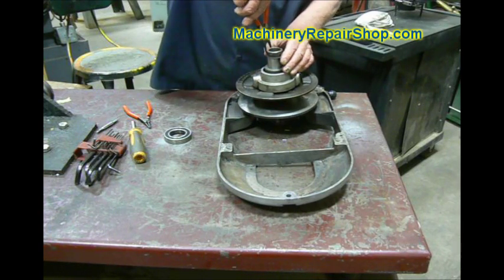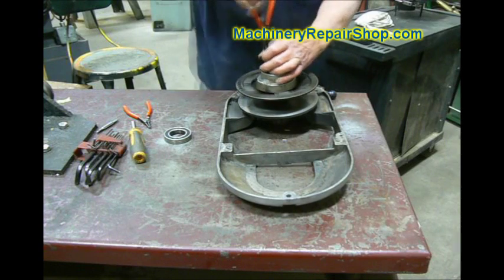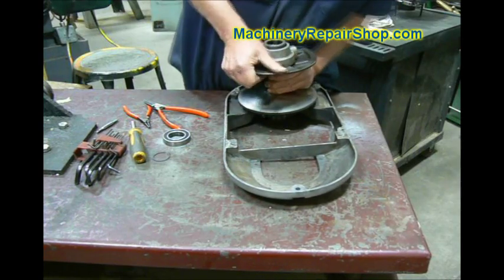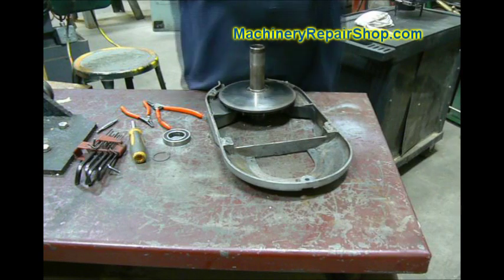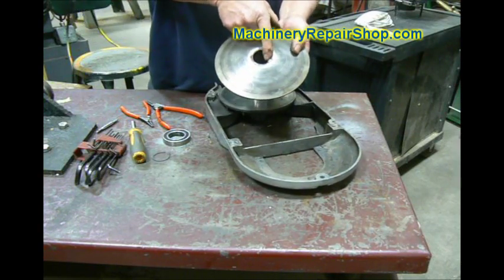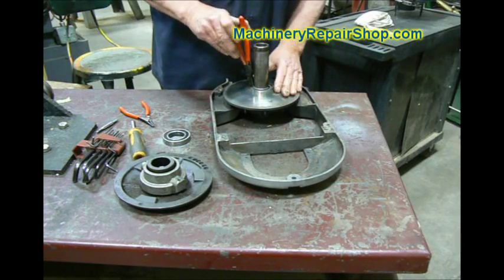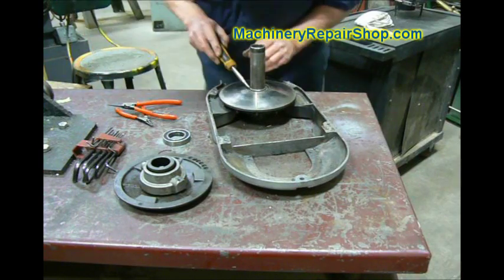This one feels good. First thing we're going to do is take off the top snap ring. We can slide this pulley off. You can see in there are the plastic bushings and the key that it rides on. Before we disassemble any more, there's one more snap ring in here that we're going to eventually take off, so I'm going to get it right now. That actually sits on top of this pulley — sometimes it's a little pain to get out; they get stuck in there.